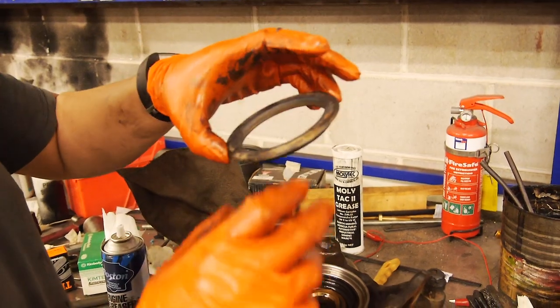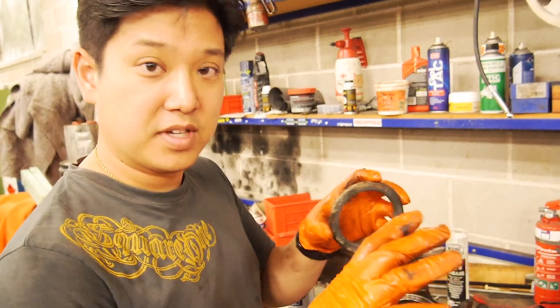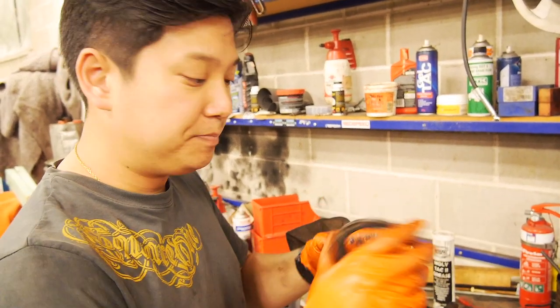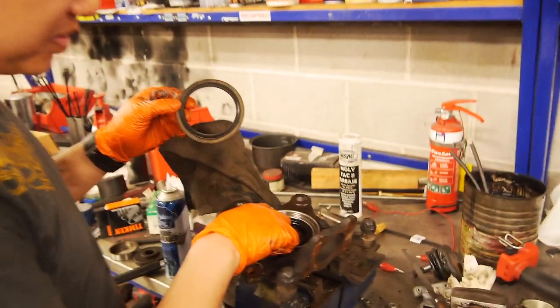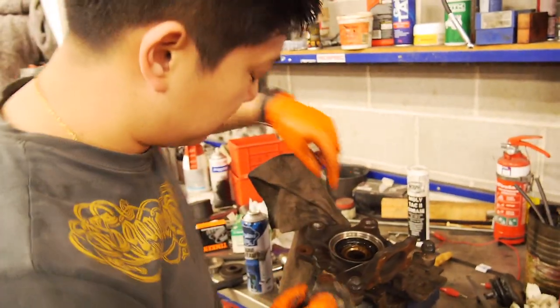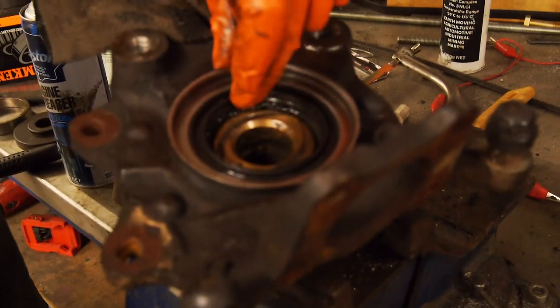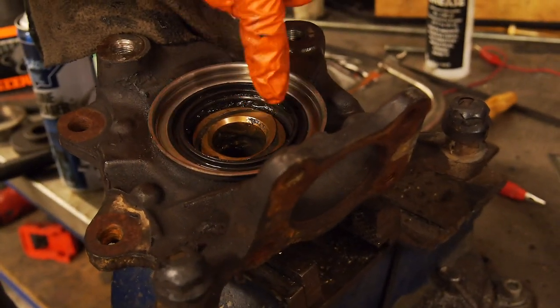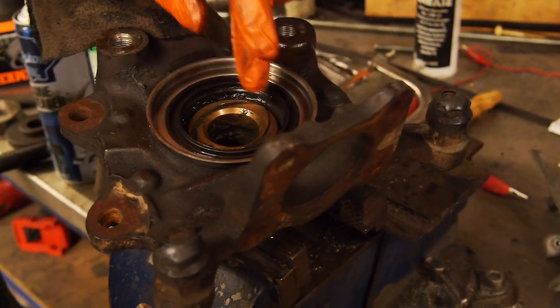Basically what happens is this V-ring part rubs on this flat surface here. Then there's a seat on the CV which seals against this oil seal part here. And then this folded press metal part is a cover that goes over the whole lot — it sits in like that, pressed again. You can see that's the springiness of the V-ring. The formed steel forms a labyrinth, and then there's a V-ring. The grease lubricates this surface here. This ring needs to be a tight fit onto the CV so that it gets driven around.